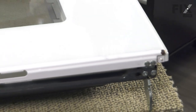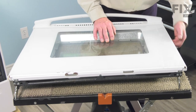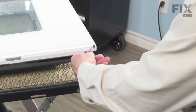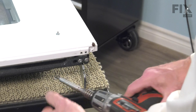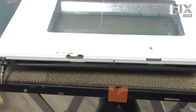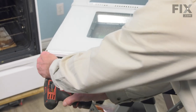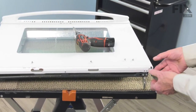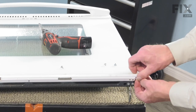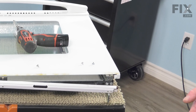Now, with the door removed from the oven, our next step will be to remove this bottom trim piece and then we can access the side trim. We'll just remove two screws on either end and one in the middle. If you wish, you can actually leave the last screw in just loosely. At this point, we're going to pull that bottom trim away from the glass. Don't pull too far if you haven't removed that last screw, and just let that tilt down out of the way.